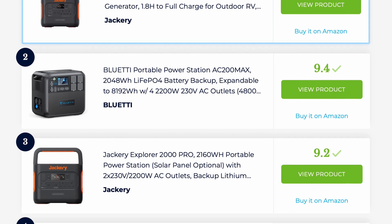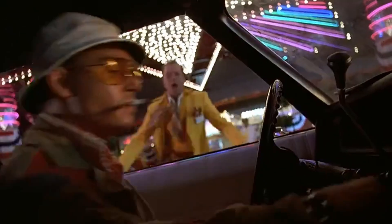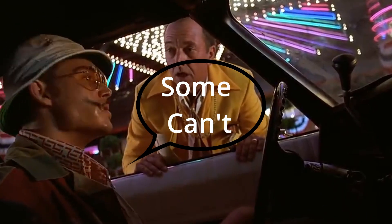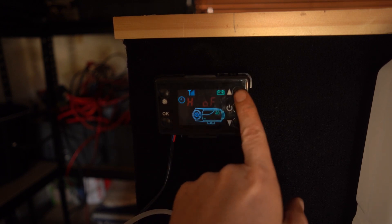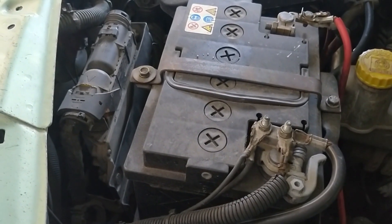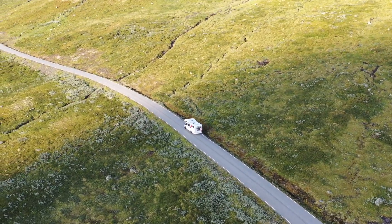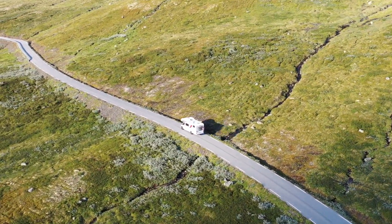Question ten: can you run one off a power bank? Many people use power banks like the Bluetti, Jackery, or Poweroak for off-grid use. Some can power these heaters, as they can supply enough power for the glow plug, but most power banks with 12-volt outputs are only 10 amps, and these heaters require 11 amps on startup. If you use one, you need a 12-volt output over 11 amps, but even then it won't last long. It's far better to run them off a 12-volt battery charged via solar, or via the alternator with a B2B charger or split charge relay to keep the battery topped up. You could use a power bank in an emergency, but not all will be capable.